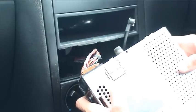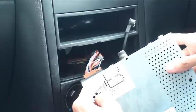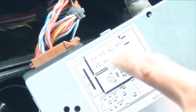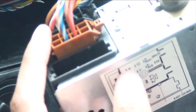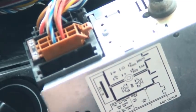On most head units you've got a little diagram of what the plugs at the back do. It doesn't matter if you don't know what they do, just as long as you can read the diagram. You can see it says the back block is power and the front block are speakers as per the illustration. You've got the power block at the back, then you've got speakers, then you've got data in and data out which is the CD changer. So you've got power at the back, next block down is speakers, and the data is spread over three sections — one, two, and three. The far left one is the data being the CD changer.